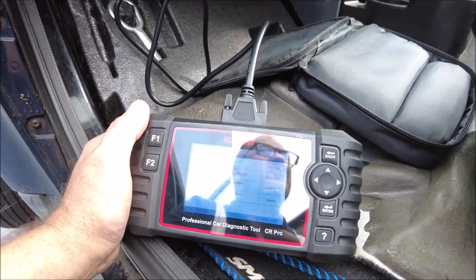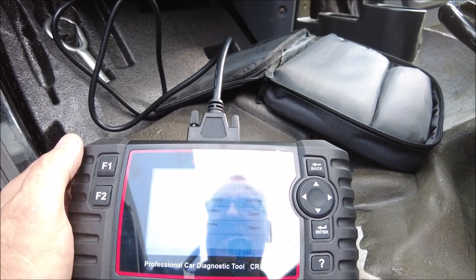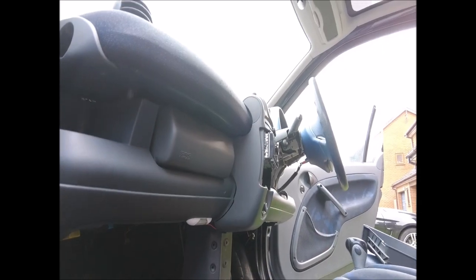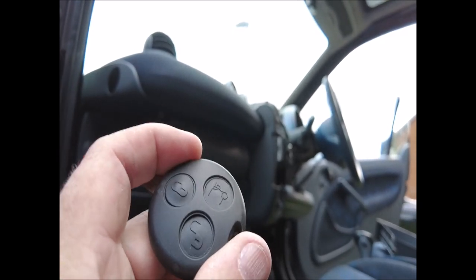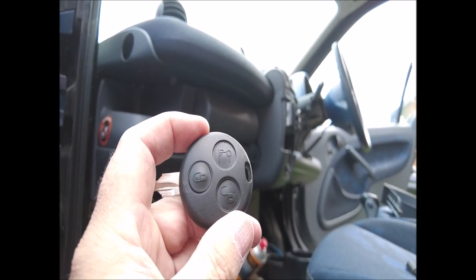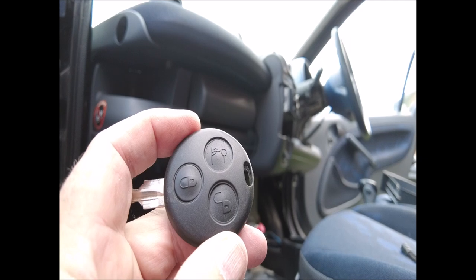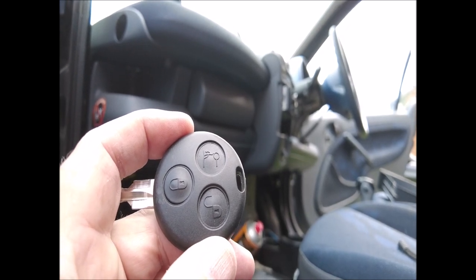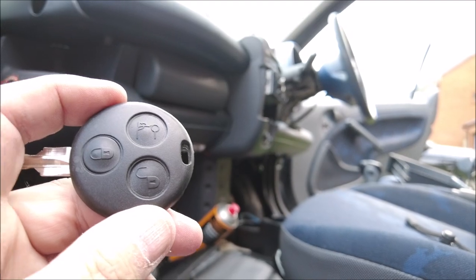It does know when the doors are open. I think it's all down to these keys — that is really concerning because I'm guessing getting keys programmed is going to be a tad expensive. I'm getting nowhere at the moment. I believe the keys are the problem right now. I don't know why because the car was apparently running before it was parked up. I've got some more batteries coming for these today just in case — I don't think it is the batteries because when I tested them there was voltage there, but there seems to be a problem where it's not seeing the key. Some investigation to be done. Let's hit the internet.